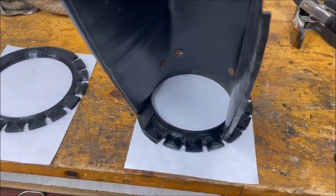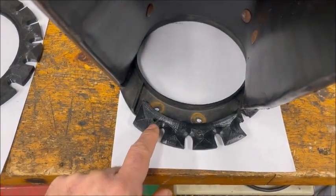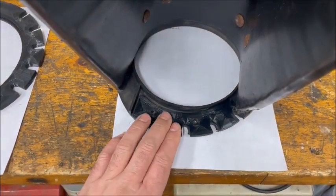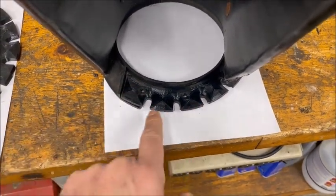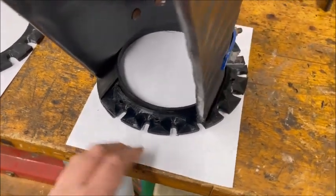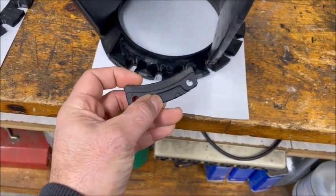All the parts have been 3D printed. Since my print bed isn't big enough, I printed it in three sections — one, two, and three. I drilled the holes after the fact by clamping the parts onto the chute with spring clamps, since I wasn't sure of the exact hole locations during design. There are no walls around the holes, so over-tightening could squish the material, but I printed at 50% infill and as long as the pieces don't move side to side it should be fine.